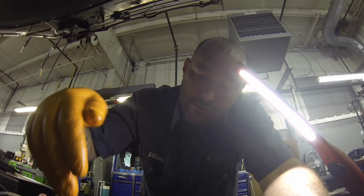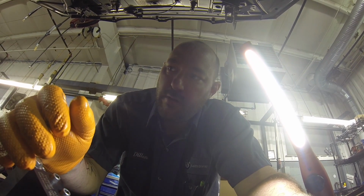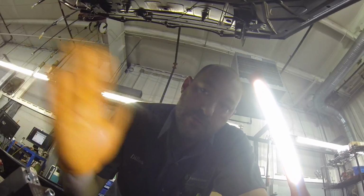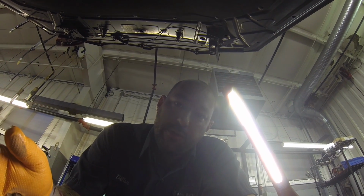You can pin it so there's a mark on the camshaft. I don't know if you can see them. Yeah, you can't see them under the tool. There's like a matrix stamp, like a QR code. They started doing that on a lot of the engines, just so you can tell the camshaft's pointed up. If you don't have that, look at the lobe separation, which way the intake lobes and exhaust lobes on the camshaft for cylinder 1 are pointed.